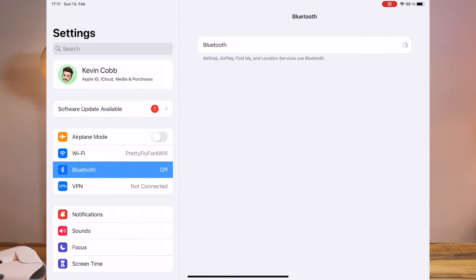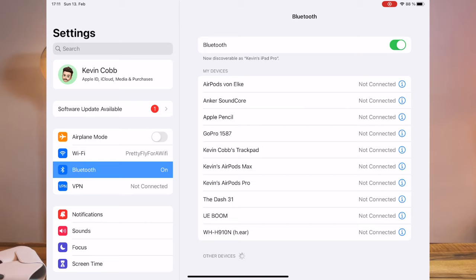Once you've done that, if you turn on your AirFly by holding the big button for five seconds, it should automatically connect to your AirPods. If you want to switch back to your iPhone, turn off the AirFly Pro by holding the big button for five seconds, re-activate Bluetooth on your iPhone, and if it doesn't connect automatically, head into Settings, Bluetooth, and select the AirPods of your choice.